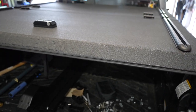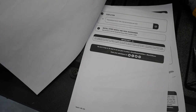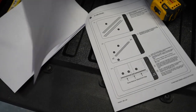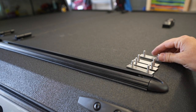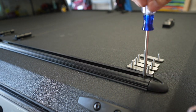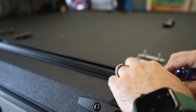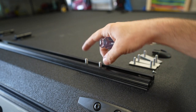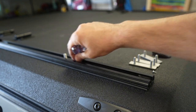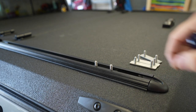Let's dive into these cross bars. There is literally no mention of the cross bars in the instructions - that's the only instruction you get. Let's figure this out. I have the two-bar system, so they came with four T-slot mounts. All we're going to do is remove one end cap on each of the rails, get that little screw out, slide this in, and that's going to attach to one bar. I'll go one far back because I have a larger tent, and then one kind of in the middle of the other rack. Then just put your end cap back on and do this three more times.